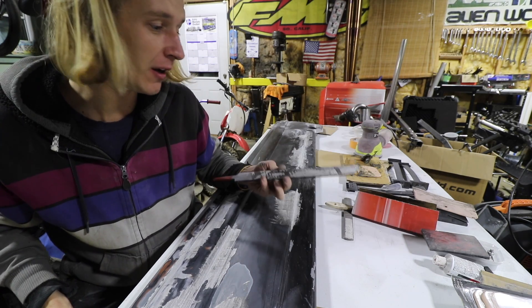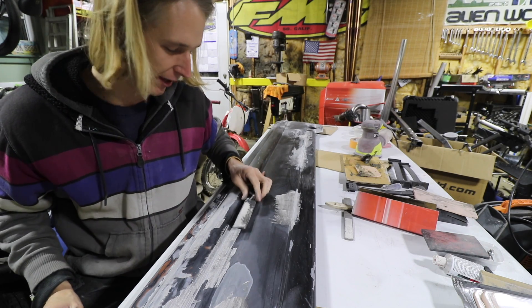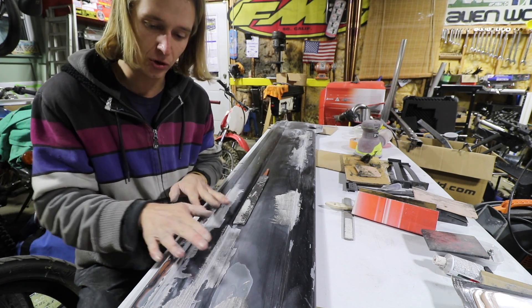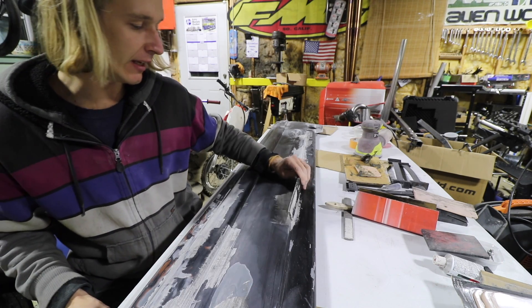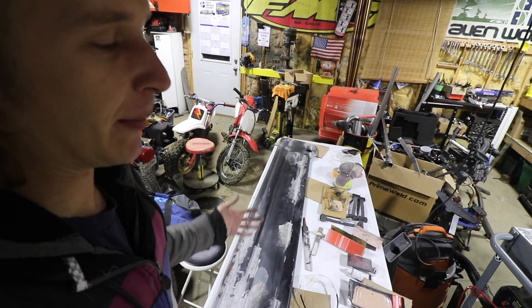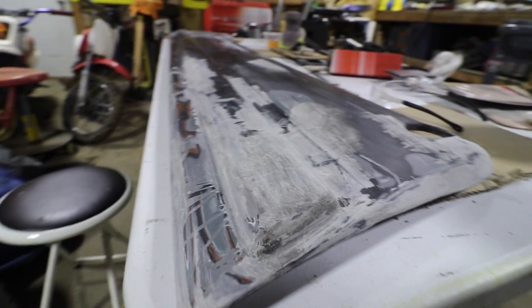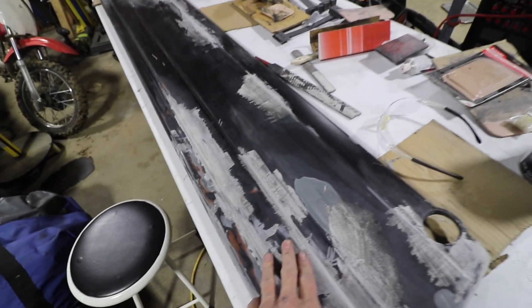This file is helping me a ton. It's pretty coarse — I'd say it's for aluminum, to really hog out some material. But the straight edge on this file is helping me so much because as you slide it along it can't get all crooked. If you're using your fingers you can go real low, and on the top you can go at an angle too. It's about 12:45. I've been sanding, bondoing, Dremeling, and hogging out fiberglass for hours, and honestly I got further than I thought. It's pretty straight — all the corners and edges are good. I got most of the cracks and falling-apart fiberglass replaced with Bondo glass.